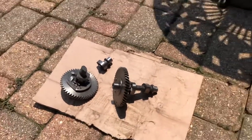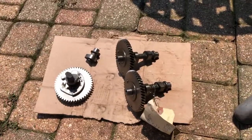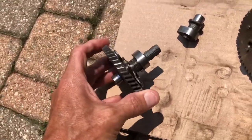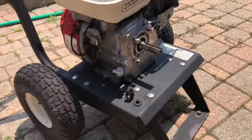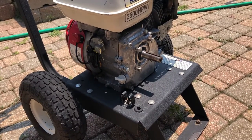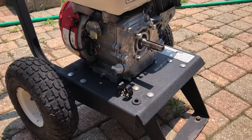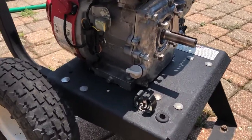I've actually got an incorrect cam too - let me grab it. Make sure you look up your exact part number, which is the rule anyway. Here's the cam that's broken - it interferes with the connecting rod if you don't time it right, and that's exactly what the previous owner did. He took it apart because he claimed it was leaking at the crankcase cover gasket. Well, I don't believe that. This engine was never apart - this is Japanese-built Honda. They don't leak at that gasket unless somebody's had them apart.